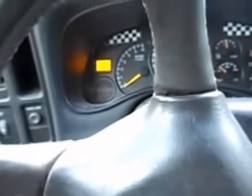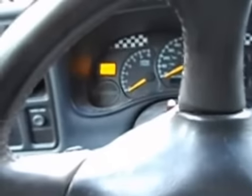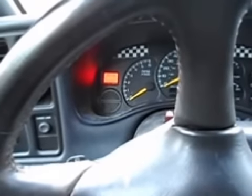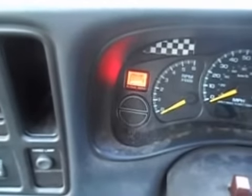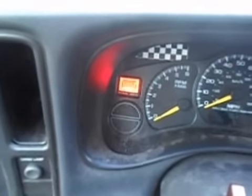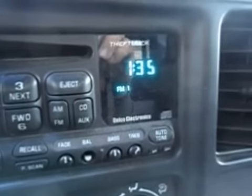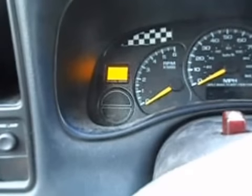I went to start the truck and it wants to start up then shuts off. What that means is the security key is lost, probably when I disconnected the battery. I was told you need to turn the ignition switch on and wait 10 minutes — you can see the battery light flashing and it flashes up 'security.' We need to wait until it stops flashing and the battery light goes red. I started at 1:31 and it's now 1:35, so about six more minutes to go.